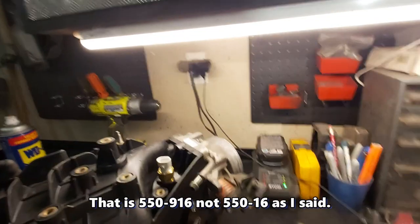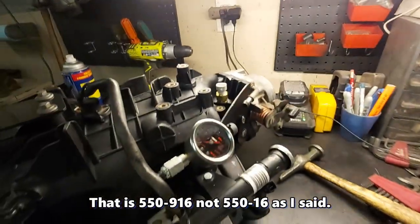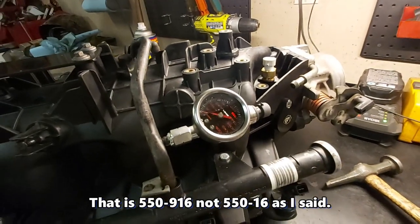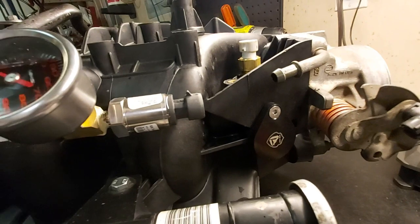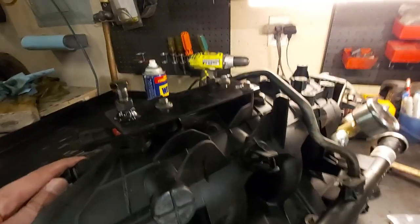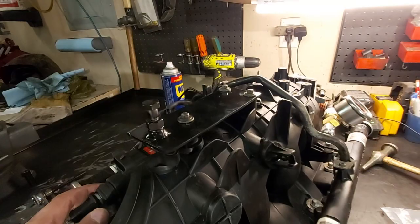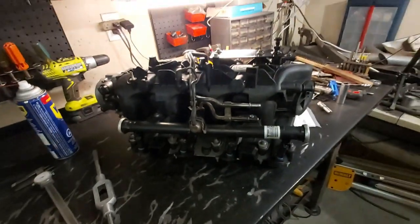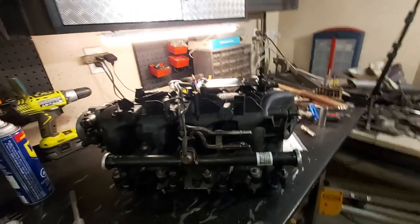And this is a cable operated throttle body. And again, here's our fuel pressure gauge, making sure we have 60 PSI at the rails before we start the engine up. And this thing here is a pressure transducer that sends our fuel pressure reading to the Holley X Max screen. So that's good. And again, our mounting system here that I devised with a plate to hold this map sensor in, 3-bar. And again, we're using the old style truck intake.